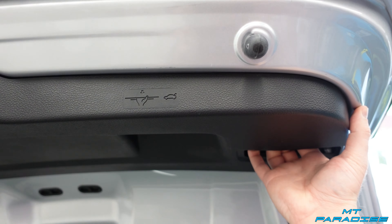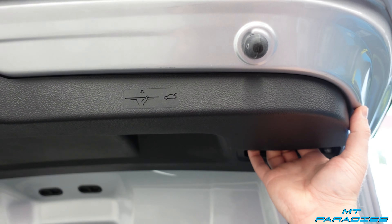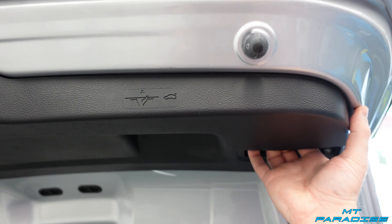If you are just replacing the taillight bulbs, you can actually pop off these little covers right here to access the hardware to take out the housing. On the inside there are these little rectangle covers that pop out, and then you can see this little white wing nut — that's how to remove the taillight on this side. With the new taillights, you're going to have a bunch of wiring that needs to go back behind here and also underneath the entire trim.